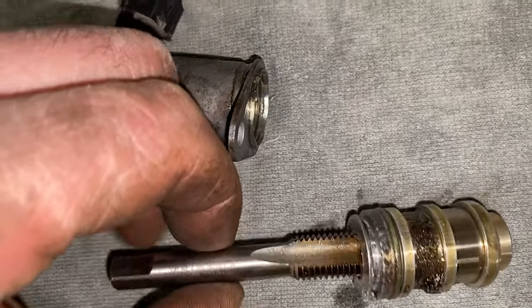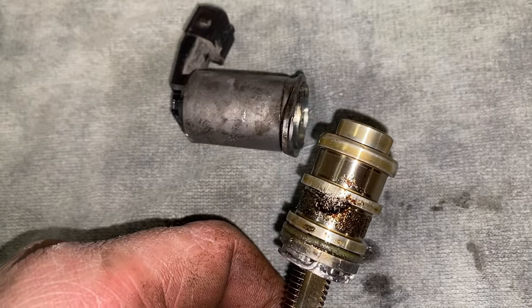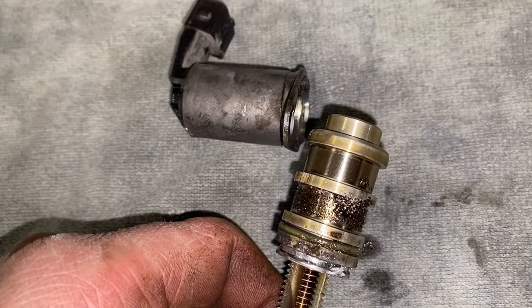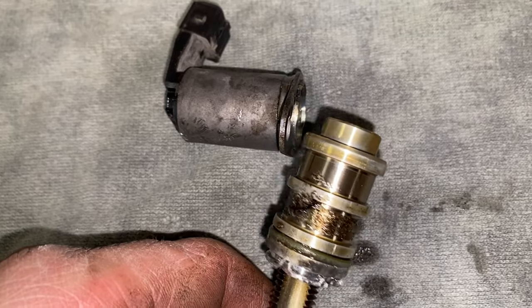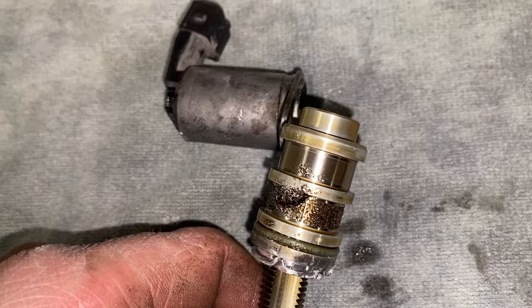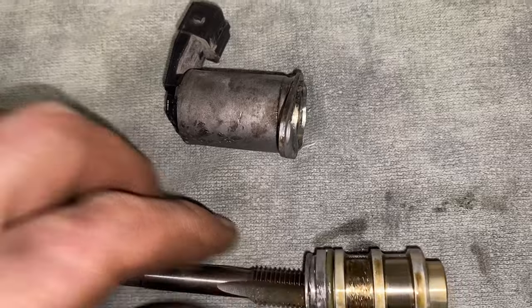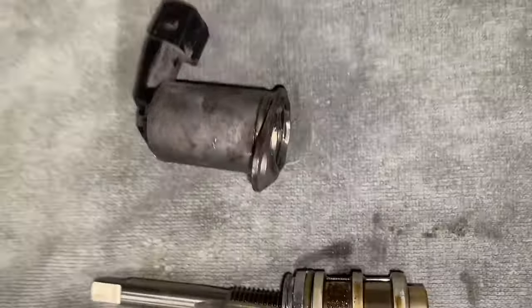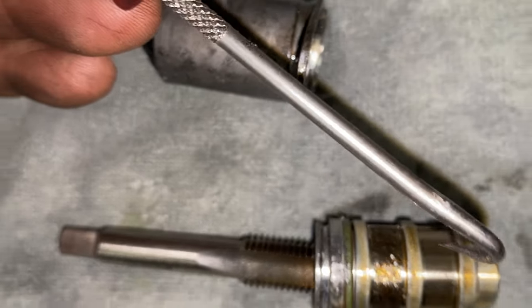So, that's the valve. It's basically just swarf and metal from, probably, when the timing chain was changed at some point. People never think about this little valve. And you can see those three parts of the bore. That's the bit where it fits in. This sort of piece here, now you've got 1, 2, 3.